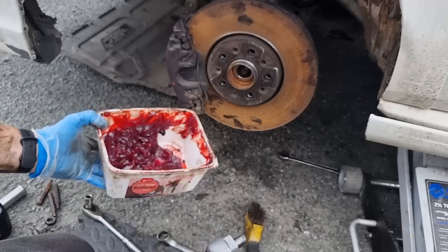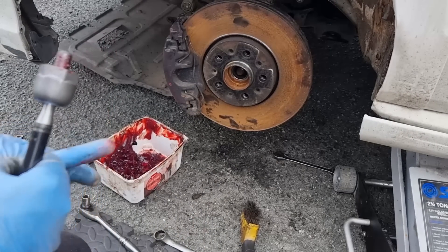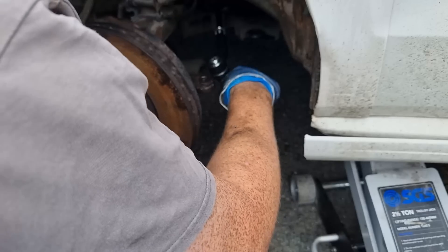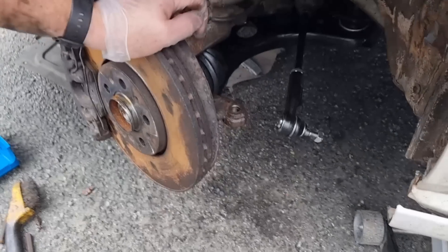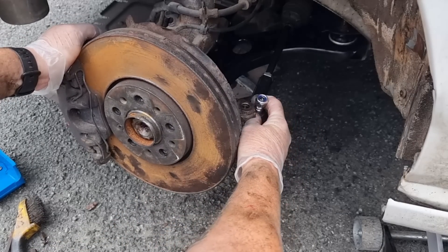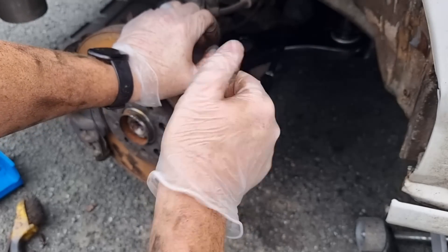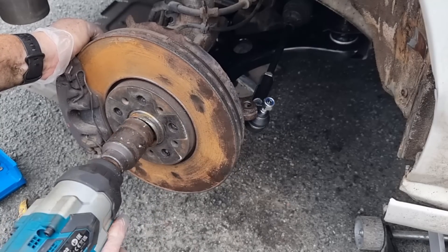I always like to make sure I put a little bit of grease on things just when screwing them down — it's not going to hurt. That front wheel is more or less straight on the other side and the steering wheel is in line center, so I'm just going to get this all in line and roughly put this in place. It's all going to be wheel aligned. Looks well tidy now, I'm happy with that. Just tightening the hub up — the cover for the steering rack needs a clip. I need to get one of those and we're going to have to do the CV boot. This is only temporary to get the car moving.